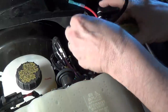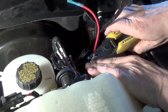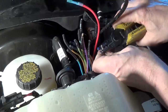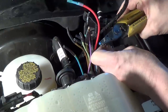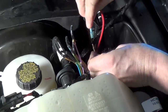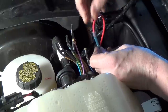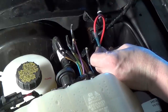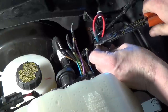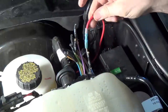It's a simple thing — take the blunt end off of that, strip the amount of wire that we need, and then using a heat-shrinkable connector, make that connection and crimp it on there. Good connection. We're on upfitter number four.